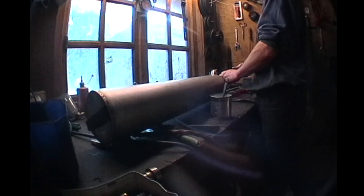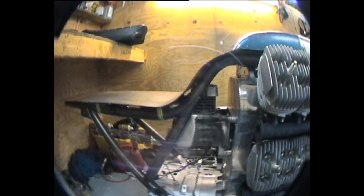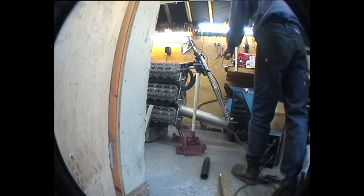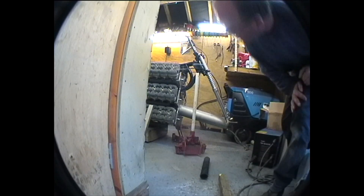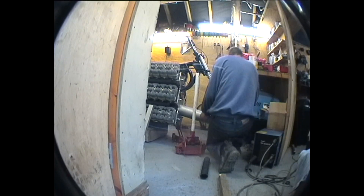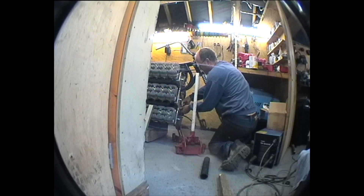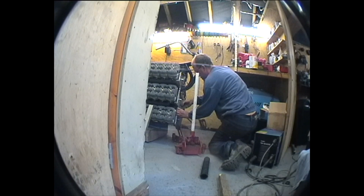There's not much room left on the bike for the fuel tank. There's a dummy fuel tank at the top, the tail piece is too small, and the air box area is taken by the donkey engine. There was however a little bit of space between the engine blocks, so the fuel tank is a stainless steel water pipe — thin wall — that slots between the bottom four crankcases. I'm just going to slide this fuel tank in. That's in.